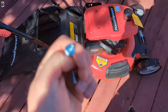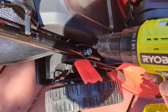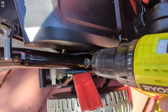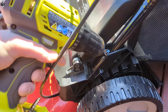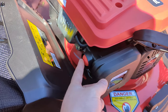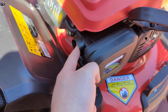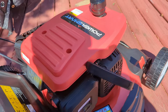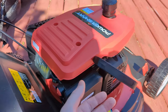Power Smart makes everything so simple and easy — even for the bolts. You could use a screwdriver to put these in. When you put gas in and you have oil in, pump the primer — I always like to pump it three times. Take your finger here on the primer bulb: one, two, three. Then give it about three seconds and go ahead and start it. It might not start the first time because there's air in the line as the fuel goes through.